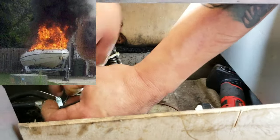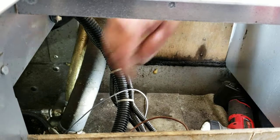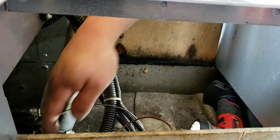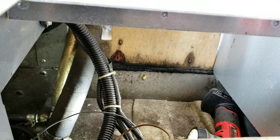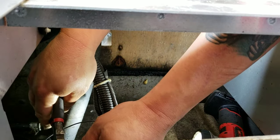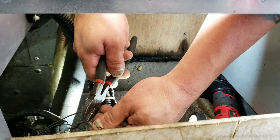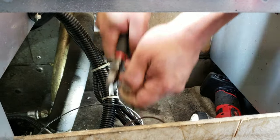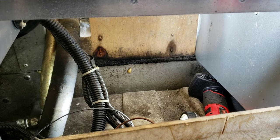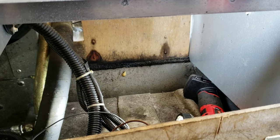So what I'm going to do now, I'm going to eliminate these factory clips that hook together. I'm going to eliminate both. We're going to double up one wire on one side of one of my connectors. Again, the idea is to eliminate bad and dirty connections. So there's no need to have this together as a harness. You'd have had to remove one pump or the other. I would still get ahead and just cut the wires and replace those connectors.